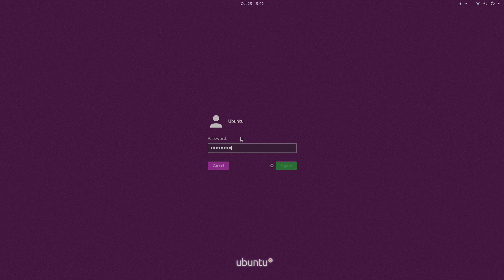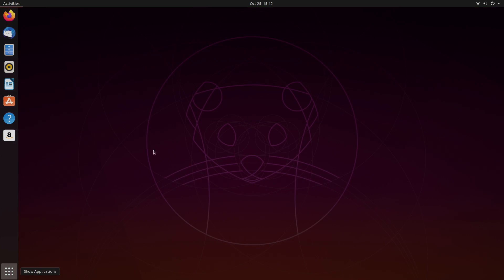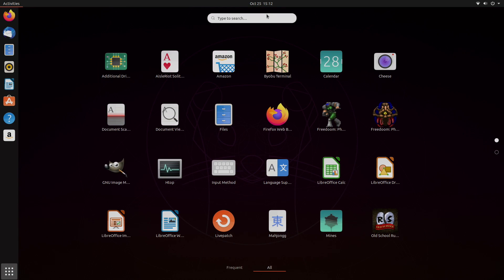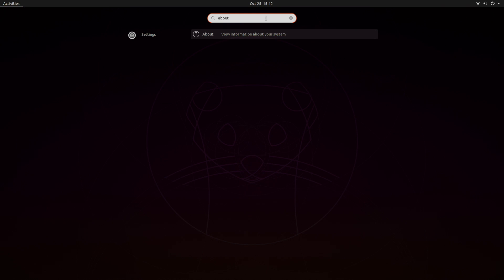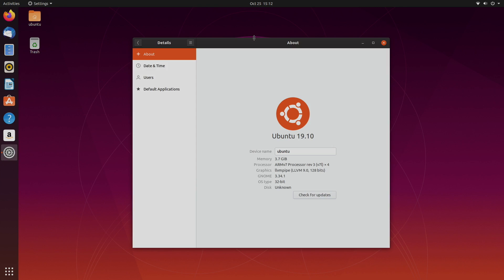What's going on guys? It's CTA Prime back here again. Today I'm going to show you how to install Ubuntu 19.10 on your Raspberry Pi 4. Canonical has recently added Pi 4 support and it actually runs really good. I do have this overclocked to 2GHz on the CPU and 650MHz on the GPU, and I'll also show you how to do that. Keep in mind you will need sufficient cooling on your Raspberry Pi 4 to reach these clocks. Overall the experience has been great and as you can see here I'm actually running Ubuntu with GNOME installed.